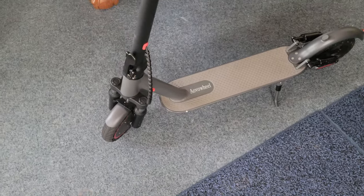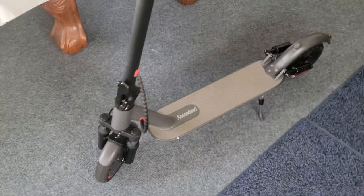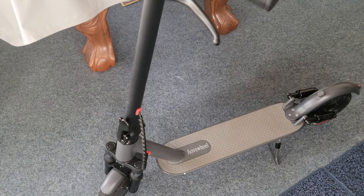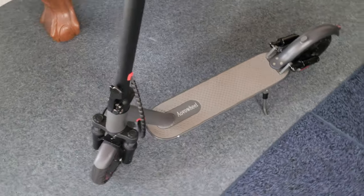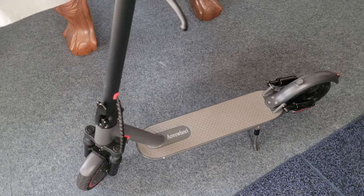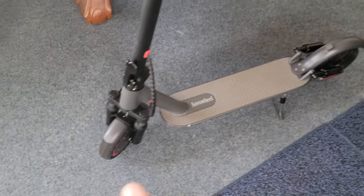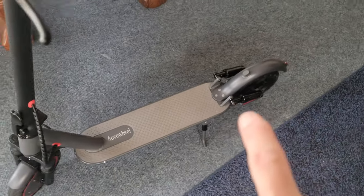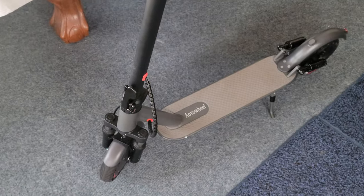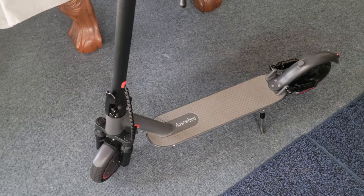It's only soft enough when you hit large bumps. When you're driving over normal road bumps, I don't notice any difference. I even had my G-force meter on my phone testing them. This does work when you hit bumps or go on grass — off-road it's definitely better than a regular scooter, no doubt about that. But driving on the road, which is what most people do, they don't really help with the vibrations at all.